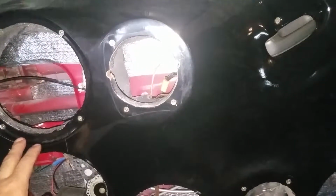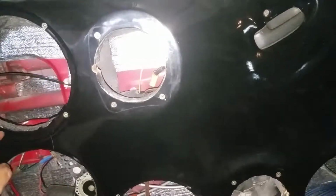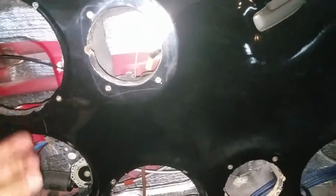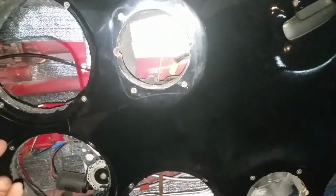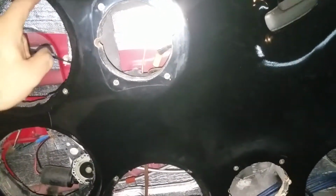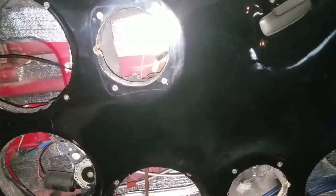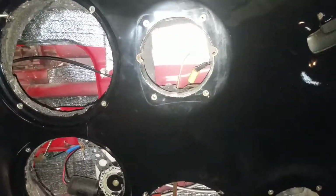I appreciate you guys viewing my short video tutorial of installing speakers in fiberglass door pods. You don't want the hassle, the headache, of finding your speaker falling out from the door because it got busted inside the wood, the screw lost its thread in the wood and doesn't grab. With the thread insert flange, the 8-32 and the 8-32 screw, stainless steel 1 inch, you can resolve that problem.